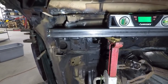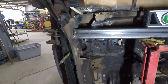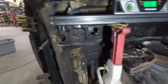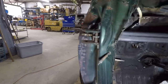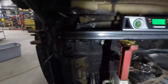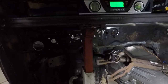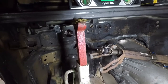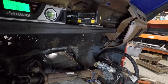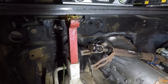What I did was take an inch and a half, eighth-inch wall tube I had laying around and tacked it in. I had the steering column set in here before to make sure everything would fit. I put it in the strongest part, so it's going to match up where both door hinges are — so if it gets hit in the side, I've got a lot more strength here. When I removed most of the Miata firewall stuff, I removed my Miata firewall mounts, so we're going to have to make something to fit. I got this all tacked in, clearanced around the glove box support. Next I'll set the steering column back in here and show you what my plans are.